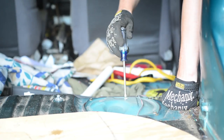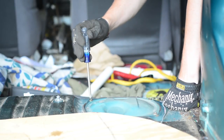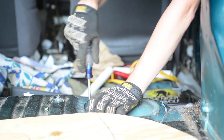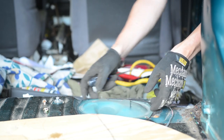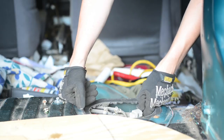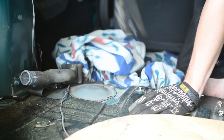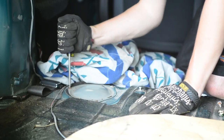The first thing we're going to do is take off the panels that provide access to our fuel pump and fuel tank — you probably saw these in the interior video. We're going to basically disconnect the electrical connectors but leave the lines hooked up for now. These are all Phillips head bolts. I've got one electrical connector in here — I think this is my pump. You just push down on the tab and pull out. Over here we have another access panel — I imagine this is either a return unit or the sender that tells your dash how much fuel you have left.